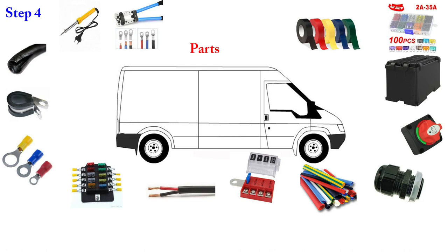You're going to need a soldering iron, and possibly borrow a crimping tool for large O-ring connections — I've used a two-ton hydraulic crimping tool. Once you have those large terminals, you need to crimp them properly with the right head — soldering is okay but crimping with two tons of force really is the way to go. You can buy the terminals and cable cheaply from an electrical store, but without a proper connection method you won't get a reliable join.